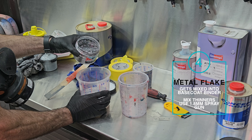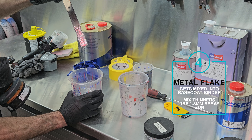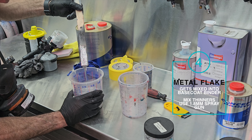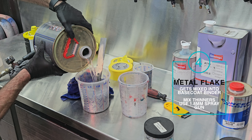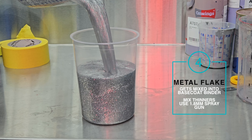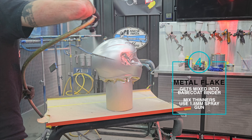Now I'm ready for the flake. I've got a clear base coat, which is also called a binder. I'm adding the flake in, and a lot of people ask how much flake do I use. It's a bit of a guess. I like to put as much in so that you can't see the colour of the ruler when you mix it and lift it up — the flake's all mixed in. Now I'm adding some thinners, 50-50, so it can spray through the gun.